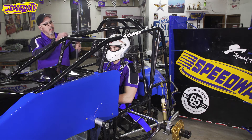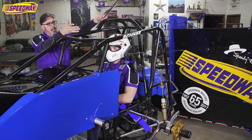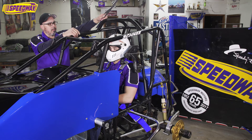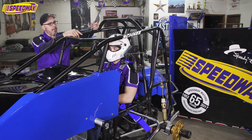With your body hanging upside down you have an inch and a half at zero g-force — that means you're just hanging upside down, so you're stretching an inch and a half. Well, if you get rolling or flipping you're going to be talking three inches, which is why they designed this, because your belts are going to stretch, your neck's going to stretch. We just don't want anybody's head coming out the top of the car.